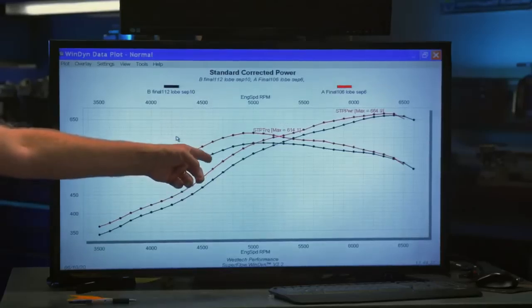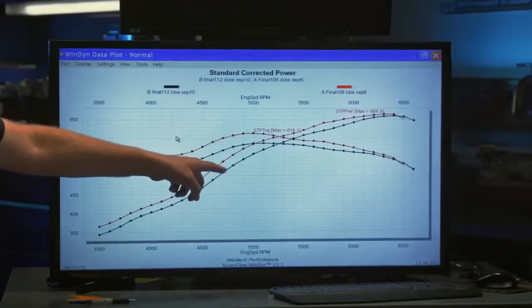I've been playing in that neighborhood so much recently that I forgot why, when you flip through the cam catalogs, all the drag race cams are on a 106 or a 104 or 108. And that's why, because, I mean, we just killed this thing. Well, even more so when you look at the catalogs, you'll see circle track stuff on 106s and that sort of thing because they want the torque coming out of the corner. Wow, that's more dramatic than I was hoping for.